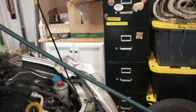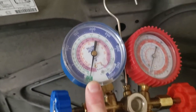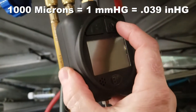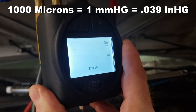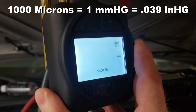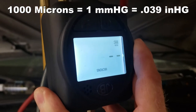I'll show you guys, it's actually working really good. It's kind of noisy in here — sorry about that, the vacuum pump is going. I showed you guys in the last video that I don't rely on this gauge because it just doesn't have the resolution to see a leak. So I use this one here — this is a micron gauge, it shows units in microns, and after initial initialization it'll show the microns. Last time I saw it, it was 720 microns which is really good. You want to get it as low as possible with the vacuum pump.